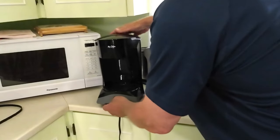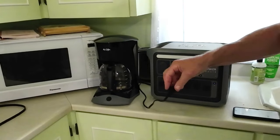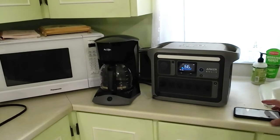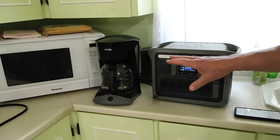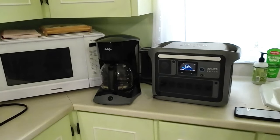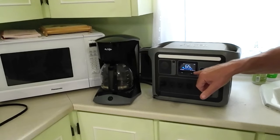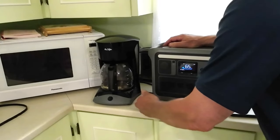The coffee maker is as close to an essential as any device for coffee lovers. With a little water in it, I plug in my Mr. Coffee coffee maker, flip the switch, and it's drawing 900 watts — exactly what it's rated at on the label. The display is also telling me I have 0.7 of an hour of battery capacity remaining if I continue to run it at 900 watts. The display is a little small but the information is clear and there.